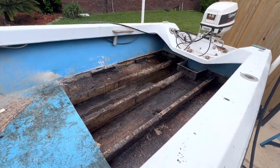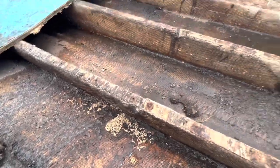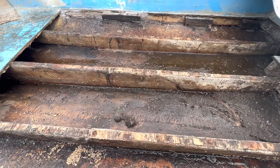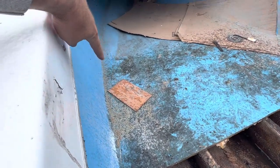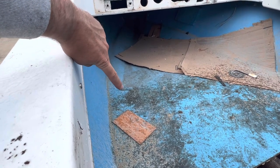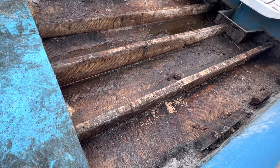So I've got part of the floor cut out. My phone overheated doing the time lapse, so I didn't get the floor-pulling on the time lapse — sorry about that. But it doesn't look as bad as I was expecting. There's lots of larva down here from insects. A lot of this glass over the stringers is really not sealed — I think it's just a single layer. The stringers at the top seem dry; I have to probe them at the base. Over here it seems like they've been eaten away underneath, so I'm probably going to end up just doing new stringers anyway. I still got to cut the front out — just finding the right line where the floor is and not cutting through the hull. I think it starts right about there, so I just got to cut up into the V and peel that one out. It's about to rain, so I'm taking a break and I'm going to spray this out as much as I can to get a good clear inspection when it dries.